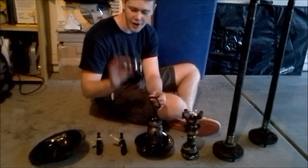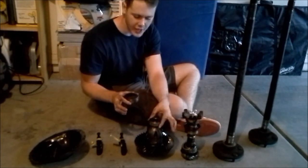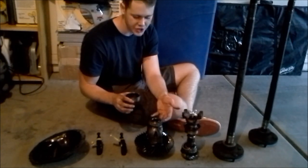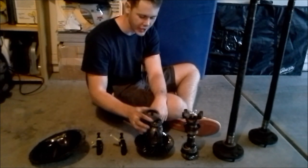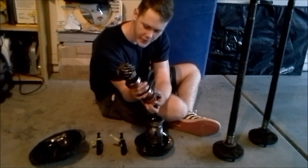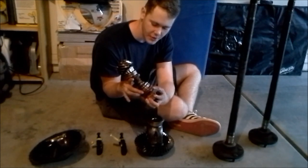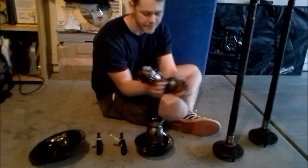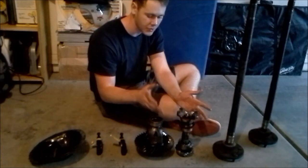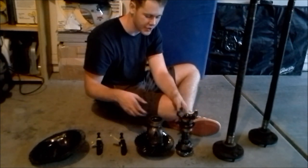If you take the shim and race off, you can see a bearing — good idea to check these while you've got it all apart. If you need to replace them, just press these off and press the new one on. Here's our pinion gear: we have the gear itself, a bearing, a race, a crush sleeve, and then another bearing, race, and our seal. Make sure you don't leave any of the old races in the axle housing, or you'll buy a new one and wonder why you've got extra parts.